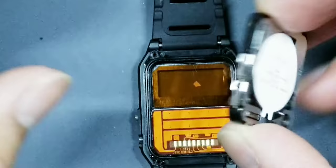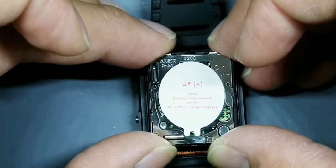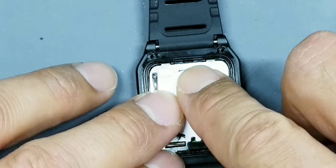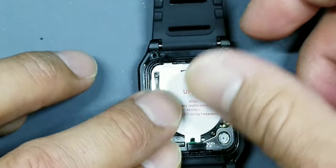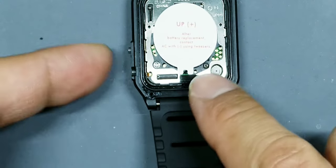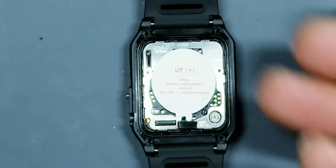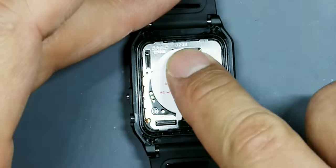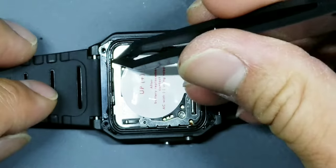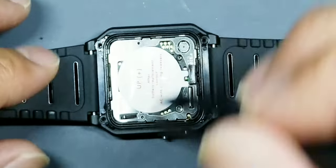Take our watch, hold it upside down, take the air blaster. Flip this over, take our filter and set it down in place. Give it another blast of air for any speck of dust. Make sure it's sitting flush — that looks good. On the inside you have the pushers on the left and where they interact with the module, so just take a tool and push them out all the way, then go ahead and take your module, give it a quick blast of air.